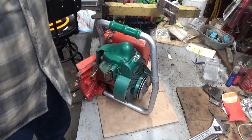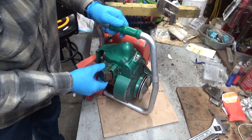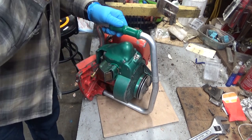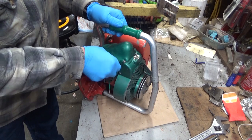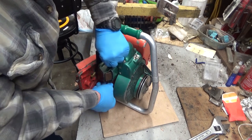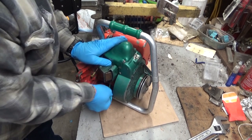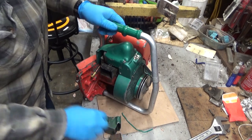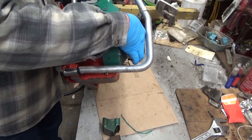There's some obvious stuff missing. We'll go through a little bit of this and kind of see where we need to go. Obviously we've got a problem here — whatever retainer screw was holding the muffler piece in place is not here. That shouldn't be that difficult to figure out. He did indicate to me that he'd inspected the piston and that it looked great, and judging by the compression I feel, I agree with that assessment.